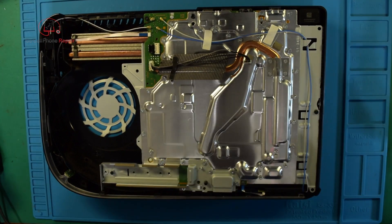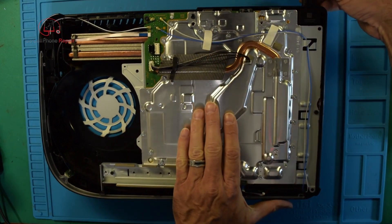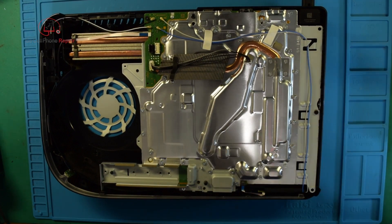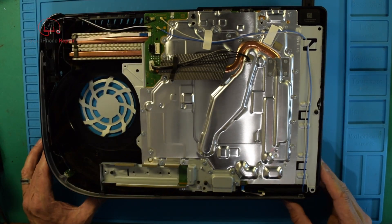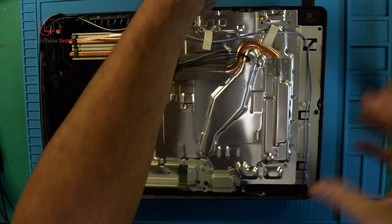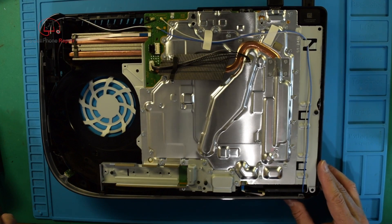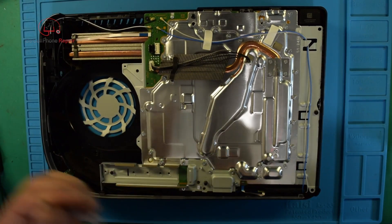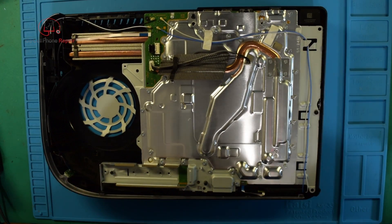I've had them act like this because of the disk drive before, so let's see if it's any different with the disk drive removed or disconnected. Still not even getting a light over here. Let's just make sure there are no signs of life — it's not generating an image. We just keep getting the beep, so I think we're missing power somewhere. My guess is it's not the power supply but a missing power rail.